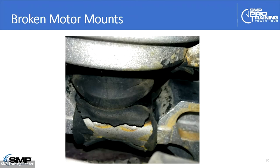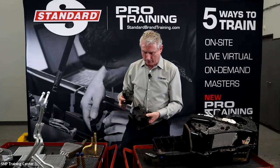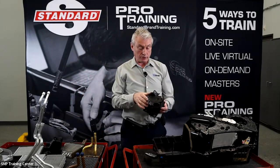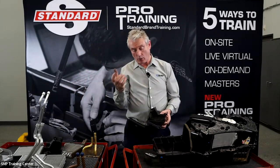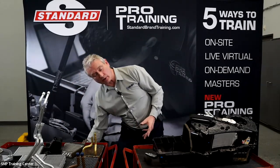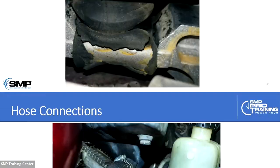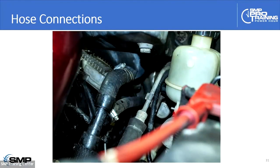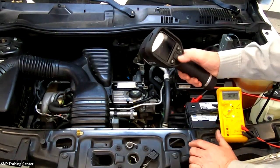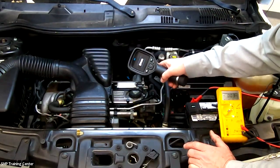Motor mounts are also a consideration. Here I've got a failed motor mount — it's completely separated. If you've got a failed motor mount, every time the motor torques up, that's straining on the heater core tubes, which inevitably results in a crack leak either at the swivel joints or at the solder joint going into the heater core. Similarly, the heater hoses and U-joints in the heater hose themselves often deteriorate due to chemical deterioration in the cooling system, so you may want to consider replacing those as well.